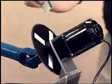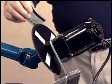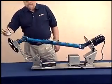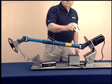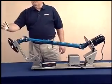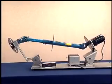With equal operating angles, the non-uniform velocity of the front yoke is cancelled by the non-uniform velocity of the rear yoke. This causes the output of the rear U-joint, the rear yoke attached to it, and the driven member to rotate at a constant speed. This is what we want: a constant speed into the driven member.